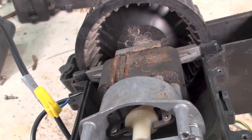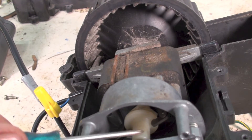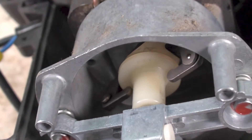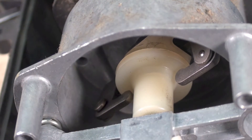This is that motor with covers off. Here's your blower wheel, and here is a centrifugal switch. That plastic part down there is going to move when the speed gets up and the weights fly out from the centrifugal force.